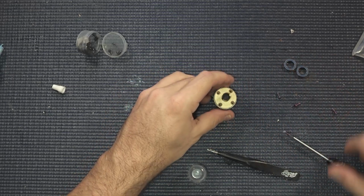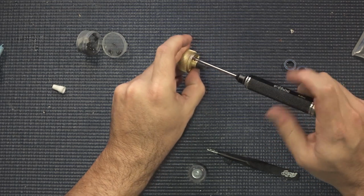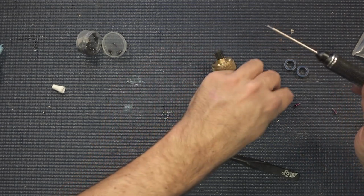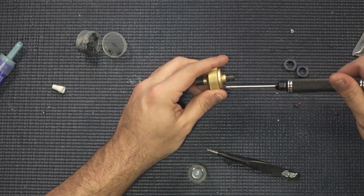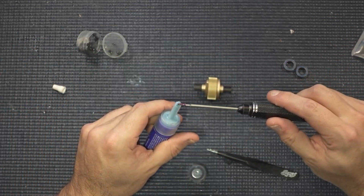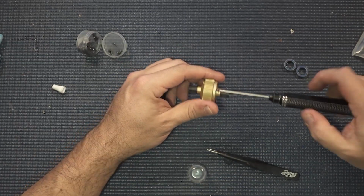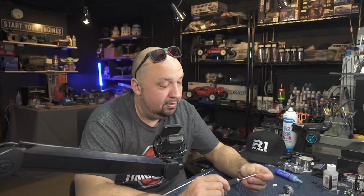That worked out great. So then we're going to start with one diff screw, and just get it started to where we start feeling some resistance. We're going to want to tighten these babies up across. So these are the titanium differential screws that R1 has. Again, a little less rotating mass. They're purple. We'll never see them except for when the diff is actually out, but it's cool to know they're in there.